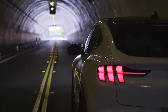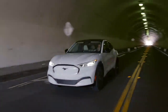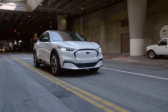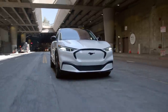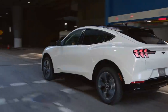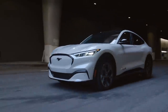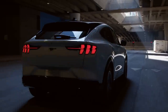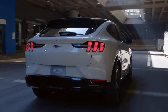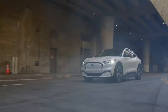But that should actually still not distract from the fact that it's a very interesting car, featuring a 75.7 kilowatt-hour battery, or even a bigger one on choice, 98.8 kilowatt-hours. So Tesla sizes for the battery, and the range for the bigger version is supposed to be 480 kilometers or 300 miles. DC charging will be up to 150 kilowatts. And you see, there are not so many electric SUVs on the market yet, so this will fill in quite well.